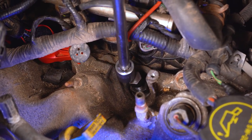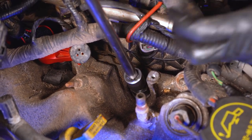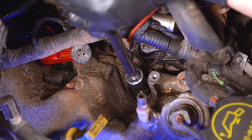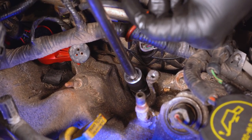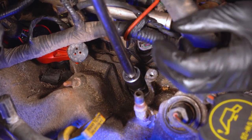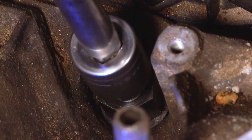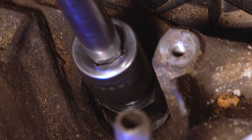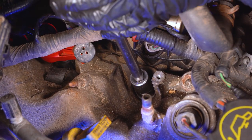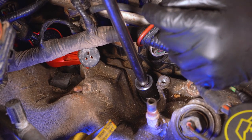Now that it's bottomed out by hand, let's crank it down. Just be ready for those noises. Here we go — listen closely. You'll hear that ceramic start to crack under pressure and push that ground strap open, break it. You'll most likely hear a louder snap as I turn this in. The first few crackles you heard was the ceramic cracking and starting to break free from that sleeve and pushing down.